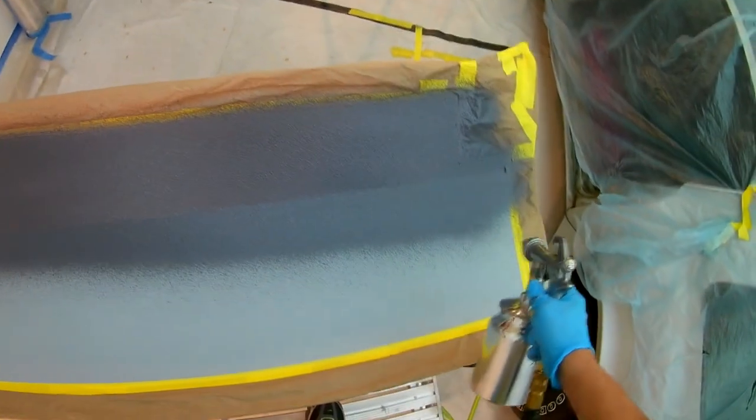There's a lot of variables with temperature and humidity, so you want to play it safe when it comes to the seven-day mark. The next benefit of using epoxy: you can continue to do body work over top of the epoxy. If you find a small place you missed and want to add a little filler, you can do that over epoxy. You're going to get that mechanical bond from where you sanded the metal, plus that chemical bond between the two products. Most epoxy primers can also be mixed as a sealer, which gives you a uniform surface for your base coat and promotes adhesion.